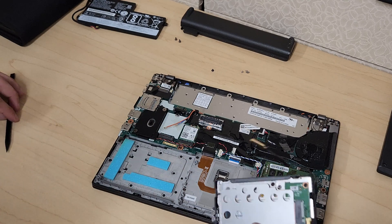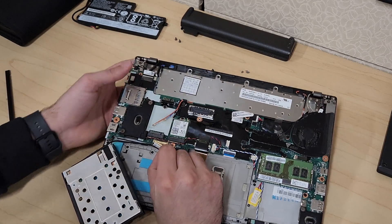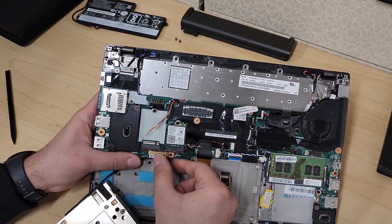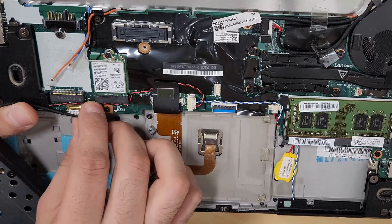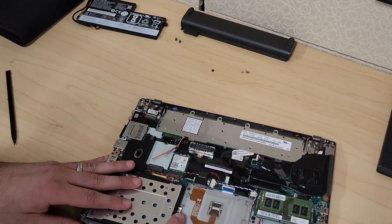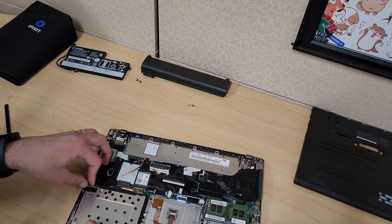To put this enclosure back on, the first thing you want to do is start with the connection — if you put the enclosure on first you won't have much clearance. Push this all the way in and it should look almost flush. Take the little bracket and push it down until it clicks into position. The enclosure sits just like so, and once you see the screw hole is aligned you're good. You can take your cable and try to tuck it back into where it used to be.